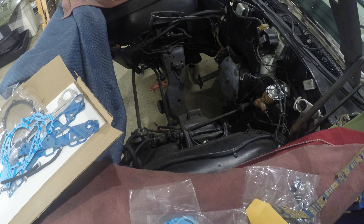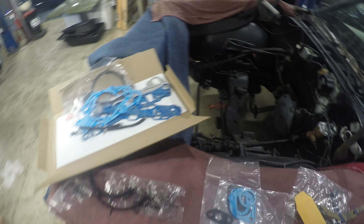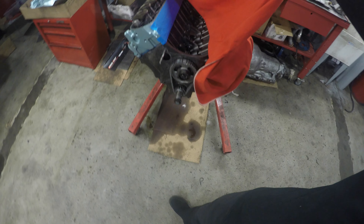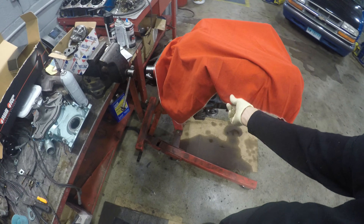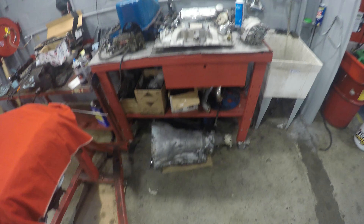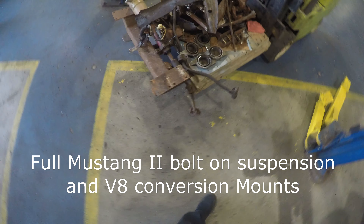This car — you can just smell how original it is, what a beautiful survivor. We're working through all the parts right now. The motor had a number seven cylinder knocking in the sleeve, so they honed it out — nothing had to be re-sleeved. Just some small issues. We're currently trying to get it back to original color and original shape. This poor motor was very sick and is now getting healed. I do have a small block Chevy and a TH350 that may go into this '40 Chevy if I can get it to do its thing.